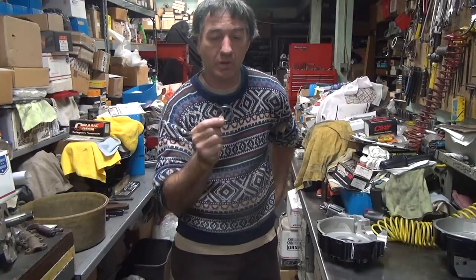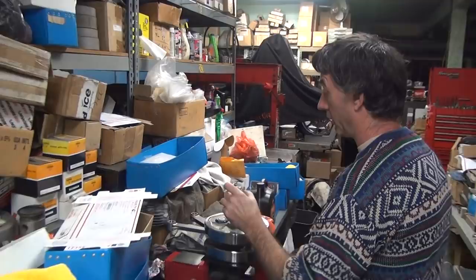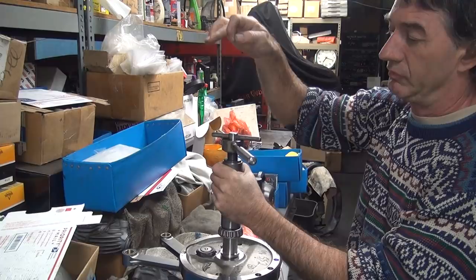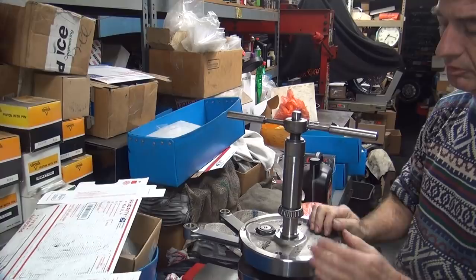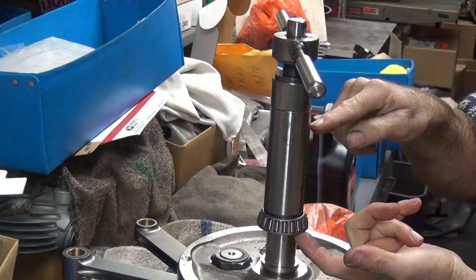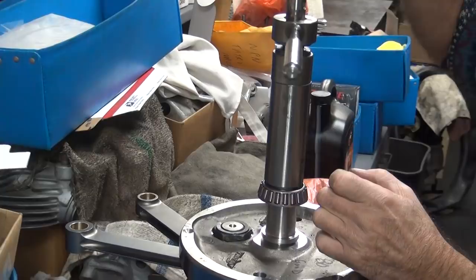There's a video if you look through our content about that - there might be some issues involved, maybe someone didn't like how I put it back together. That screws on the end of the crank. Now you go down and put the bearing down. We are not pressing on the flywheel - you do not want to press the flywheel because it goes like this and knocks it out of true. This here actually presses the bearing on the shaft but you're pulling on the shaft, so all the stress is on the shaft between the bearing and the top of the shaft, no stress on this side. If you go and beat this on with a hammer you're stressing it and you'll knock it out of true again - those are all bad things.